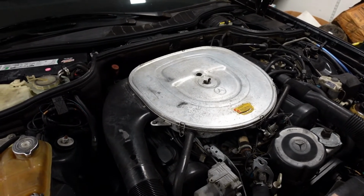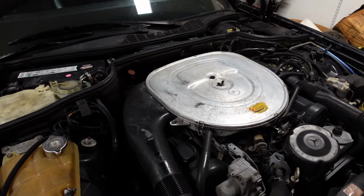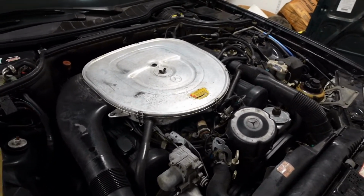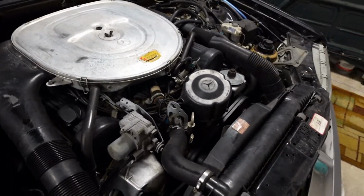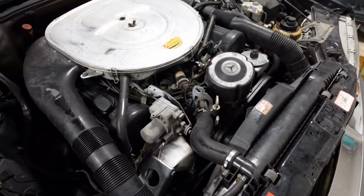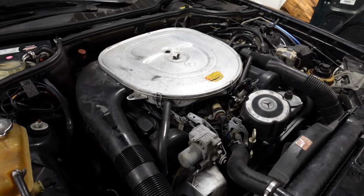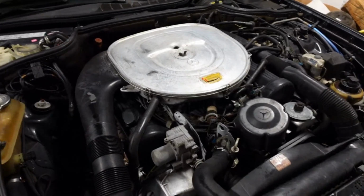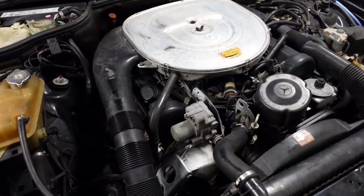I'll be using an AMPed MicroSquirt, which is a MegaSquirt system. It's about the size of a cell phone, and it would run the car in batch fire injection mode and wasted spark ignition. Once I have a good crank signal from the trigger wheel on the front, I will probably start incorporating the other sensors, such as the manifold air temperature and manifold air pressure sensor, coolant temp sensors. And the ECU will use those to calculate the air density.